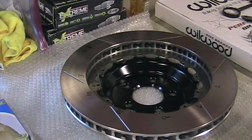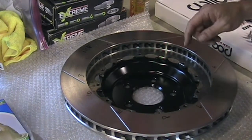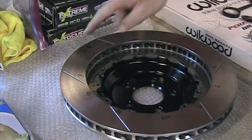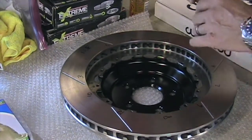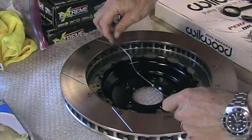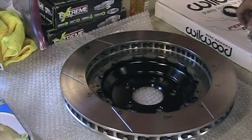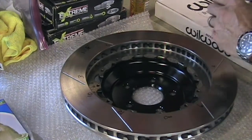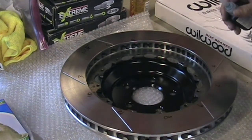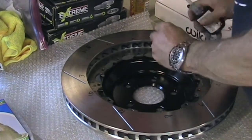I've set the rotor up on top of the hat and I've marked off all the bolt numbers, because you've got to do them in the right order — basically just crossing: one, two, three, four, five, six, and so on. I've already prepared my wire — for these particular bolts with the distance apart, about eight or nine inches is adequate. I've cut them ready, now I just need to put the bolts in, torque them down, and then do the first couple of lock wires. Firstly, the bolts with a little bit of Loctite on them and the torque wrench.